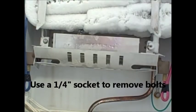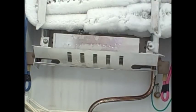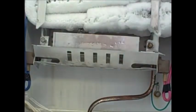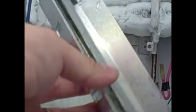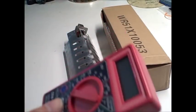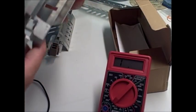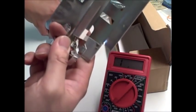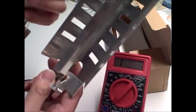First thing we're gonna test, and which is the most common cause of this problem, is the heater bulb. For this test, you need to set your multimeter to the ohm setting to test for continuity. You really need a multimeter tester because you won't be able to judge if the bulb is faulty just by looking at it, unless it's obvious, like this one, where I can see that the coils have already broken off.